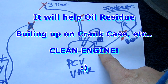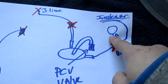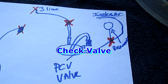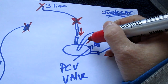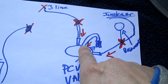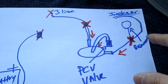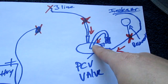Then you will see another small one come out. What I did is I rerouted all this so this goes into the reservoir. And if you notice, an X here is actually a one-way stopper — that means it can only go this way. Everything goes this way — it gets sucked into the engine. The engine uses a vacuum to suck that in. So it's actually recirculating any oil vapor, because the EPA doesn't want to put all this stuff out into the environment. Sort of like a breather tube on a lawn mower.